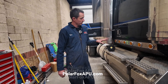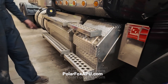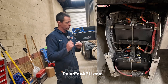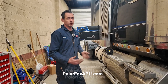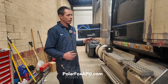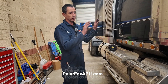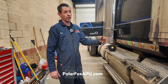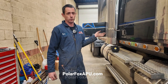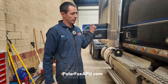Back outside — the heart and soul of our system is our dual-purpose lithium starting battery. We take out your existing starting batteries; no need to add extra battery boxes or anything. They're all right here, right where the existing batteries were. We took out the old lead acid batteries and put our batteries in. Depending on what batteries you're using, you might see anywhere from a 50 to 100 pound negative weight ratio. So when you install our system, even with the batteries, the AC system, and everything, the truck actually weighs less after. If you're running lead acid or AGM batteries, you'll see more weight reduction if you're running AGMs because they're about 75 pounds versus 50-something pounds for a regular lead acid. So another benefit of the system — no extra battery boxes and a reduction in weight.